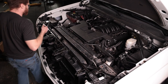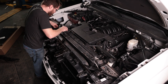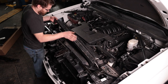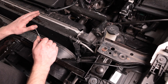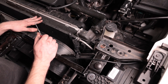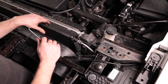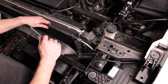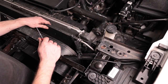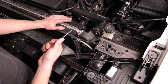Do the same thing on the passenger side. With those two released, there are a bunch of little clips along the top — just pull it up and it'll come up. Now, I haven't had AC working for about three years, as the Freon slowly escaped from wherever the damage is. But if you still have Freon in your system, you want to make sure you capture that properly. You don't want to vent that into the atmosphere, so make sure you're capturing it. My system is empty, so we're good to go.